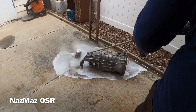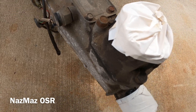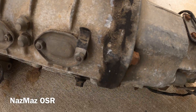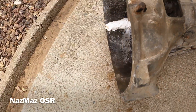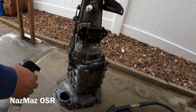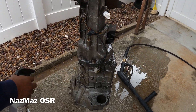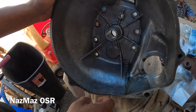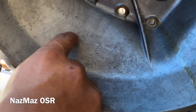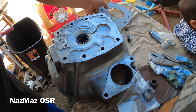As far as the tranny goes, I pressure washed it. I did notice the tranny had a few areas that were leaking — like the oil pan, the transfer case, right where the shifter went, and the little pocket there was also leaking. I went ahead and pressure washed it. There was a lot of corrosion on it — unfortunately from rain water from having it stored away. I tried to pressure wash it and wire brush as much of that stuff off. It was like electrolysis, basically corrosion eating into the aluminum. You could see some of that on the bell housing. There was a lot of pitting, so I wire brushed it, hit it with WD-40, and cleaned it up.